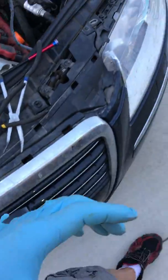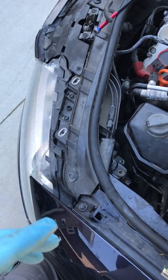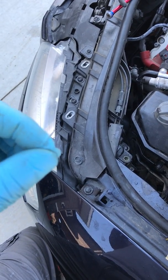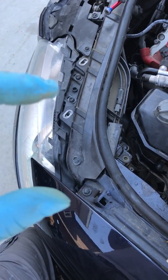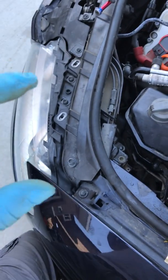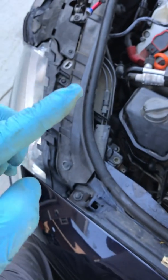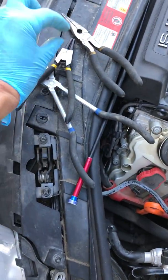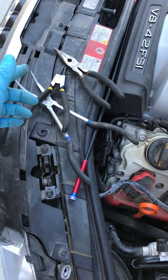When you've got it open, the wire harness plastic piece won't fit into the HID ballast when it's open. When you open it, it kicks off that connector — there's a little foot in there. So what I did, I used needle nose pliers and just pinched the end off that little foot and pulled it out. Be careful not to damage the wires inside.